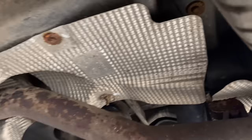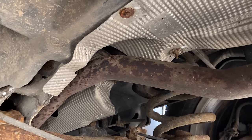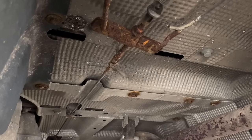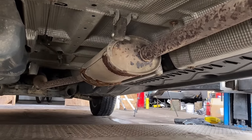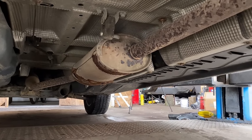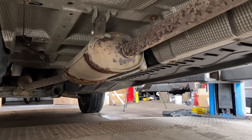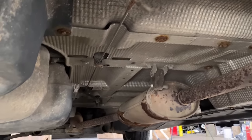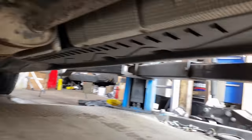The rear springs look like they have corrosion but it's just the paint — a pressure wash would lift that off, then a quick wire brush and a bit of satin black and they're good to go. Looking at the original exhaust: the VW rear box is still intact, the pipe looks really good with no holes or blowing. There's corrosion on it at 282,000 miles, but I might put a stainless on it to pimp it up. The linkage to the handbrake cable looks a little corroded — wire brush and satin black would sort that. The middle box outer layer is definitely shedding a bit of skin, but it would pass an MOT with just an advisory. All the heat shield is intact — sometimes it's all hanging down on other vehicles. I am absolutely blown away.